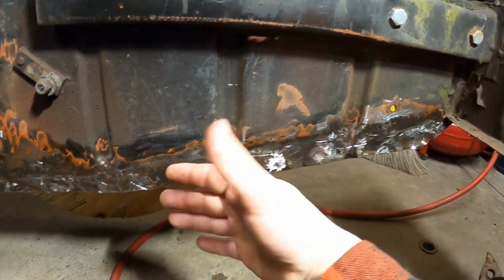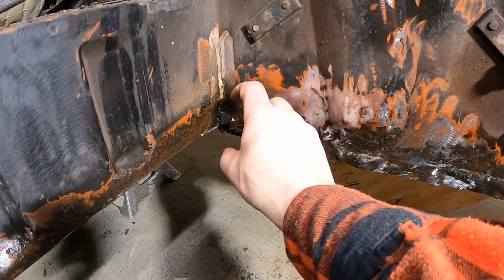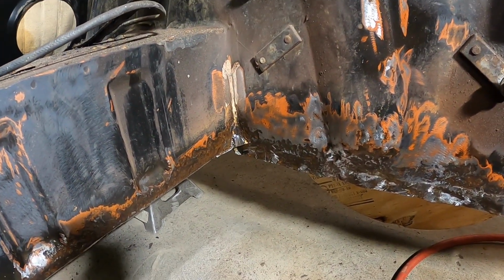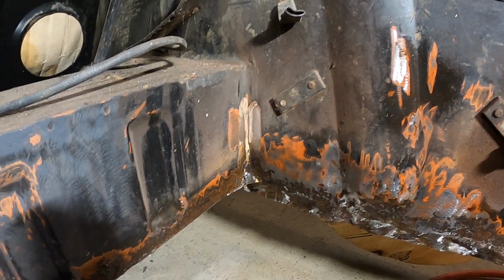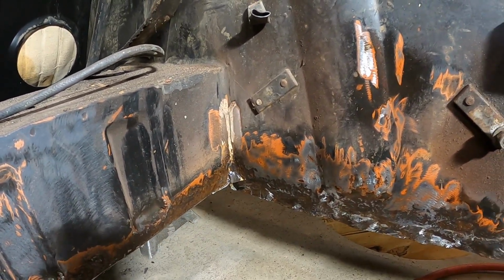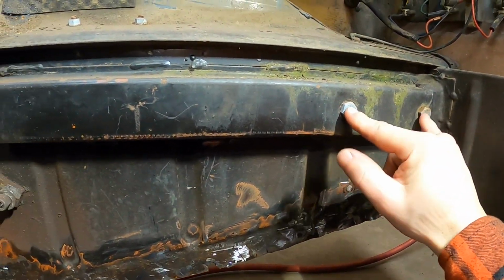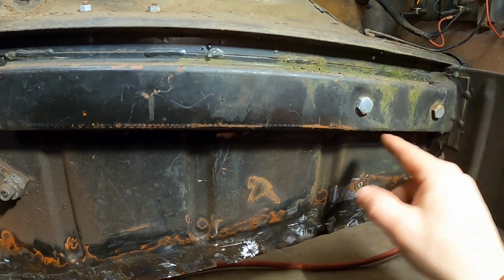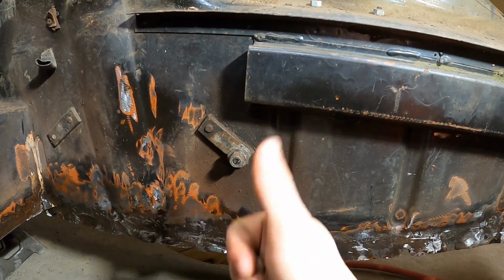But it's pretty well cleaned up in here. It's still really wavy, so I'm going to have to make that flatter. And then in the corners there are these big kind of clumps of steel. That's kind of weird. And then we have some weather strip, or the seam sealer in the corners that I'll have to take care of as well. So a little bit to do. I'm going to pull the bumper out as well, and then I'll be able to recoat this entire area, and we'll get the rest of it done.